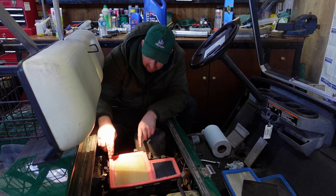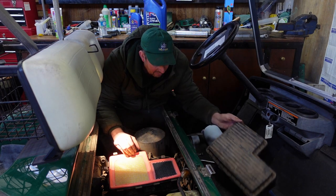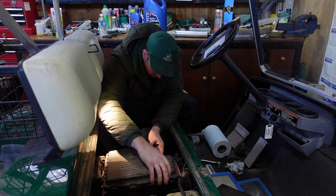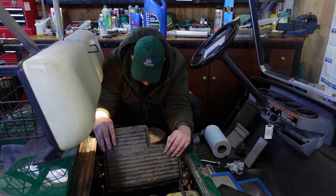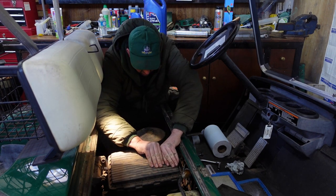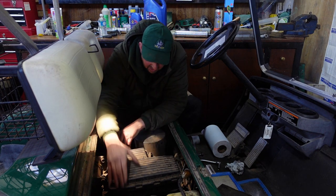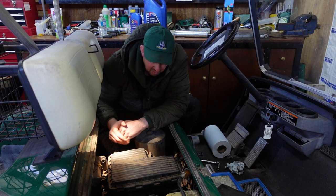When we put this down, look, this rubber makes a nice tight seal. We put the lid on and we do the clasps up and it makes a nice tight seal all the way around. Now, see if I can put it back on easily enough. It's always hard when you're doing these things blind, them over the far side. That's it. That sits on tight, forms a tight seal, and to make sure that seal's airtight, we clip these clips on all the way around. So that's it, and now it's completely sealed in there. That's the air side of things done. Now all we've got to do, move on to the fuel side.